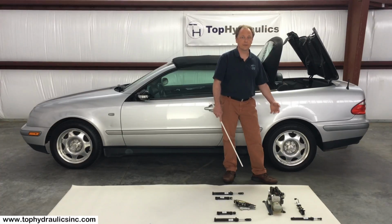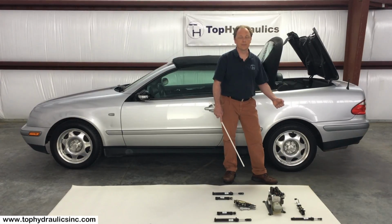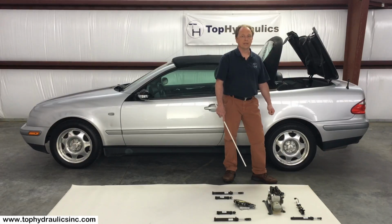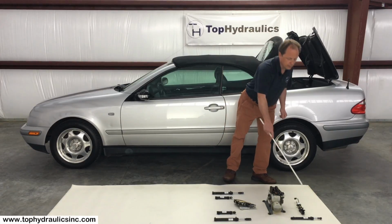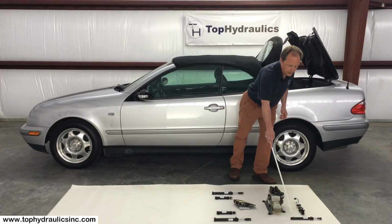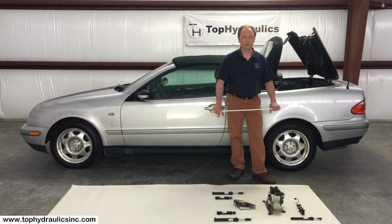They are originally made to last, unless something odd happened, like there was a lot of tension on some hose because somebody worked on the car, or there are a couple of weak spots in the design where the hoses flex around a spot, especially the hoses going to the rear bow lock, failing fairly easily, and we see more and more hoses failing going to the tonneau cover lift cylinder. But it is not typically something that you need to worry about on a preventative maintenance.